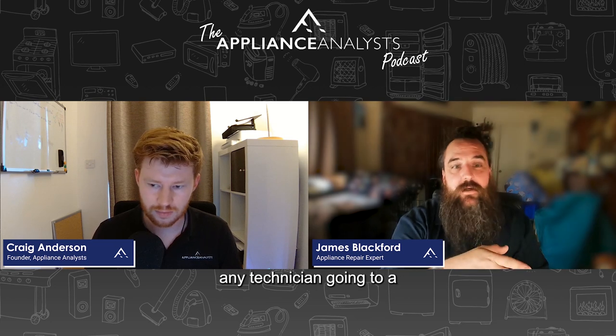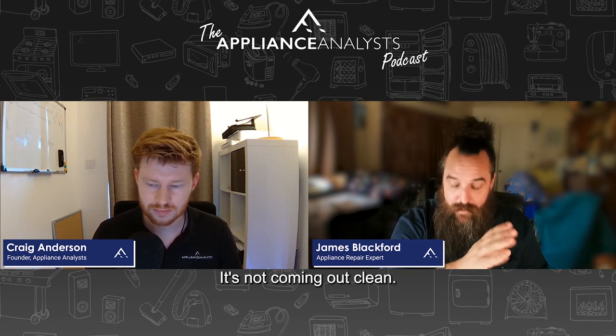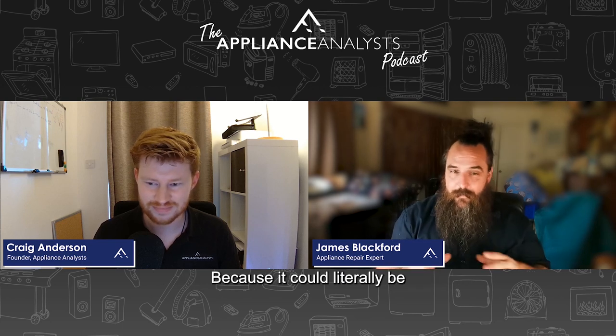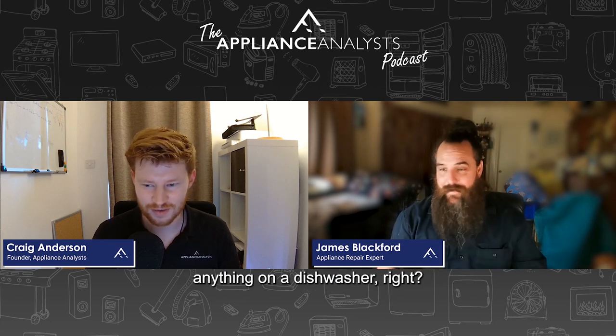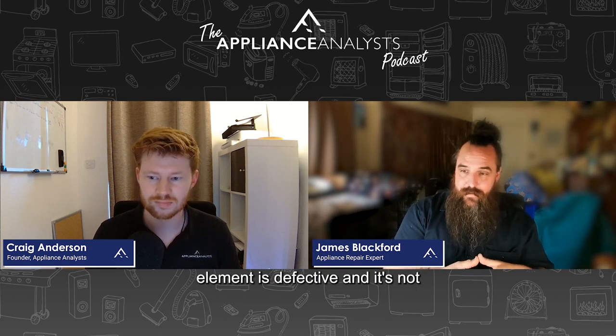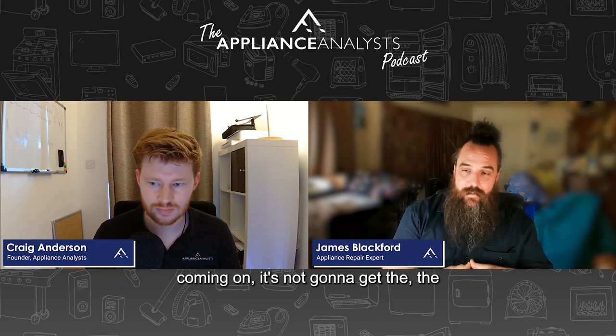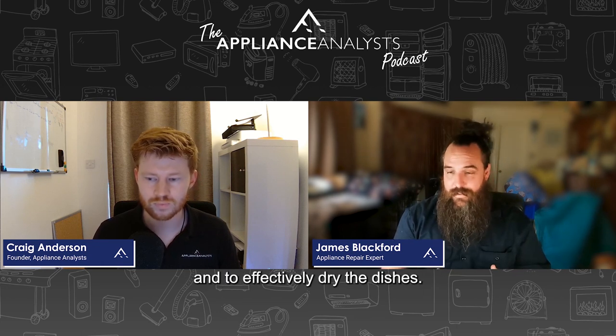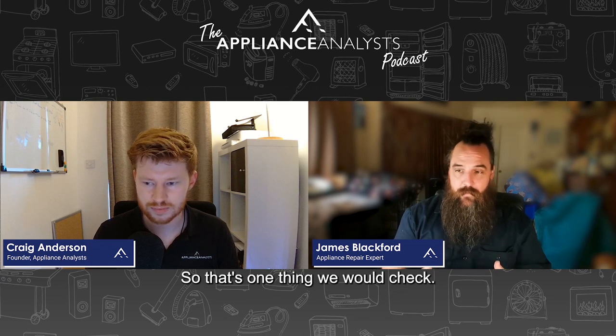For any technician going to a dishwasher that's not coming out clean, we almost put on our Sherlock Holmes hat because it could literally be anything. Starting from if the heating element is defective and not coming on, it's not going to get the water hot enough to effectively clean and to effectively dry the dishes. So that's one thing we would check.